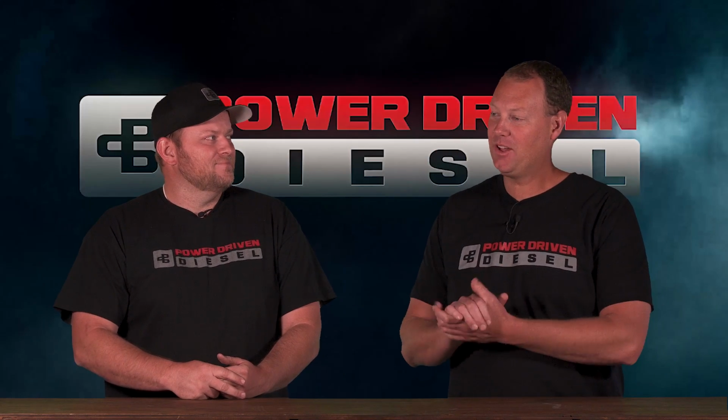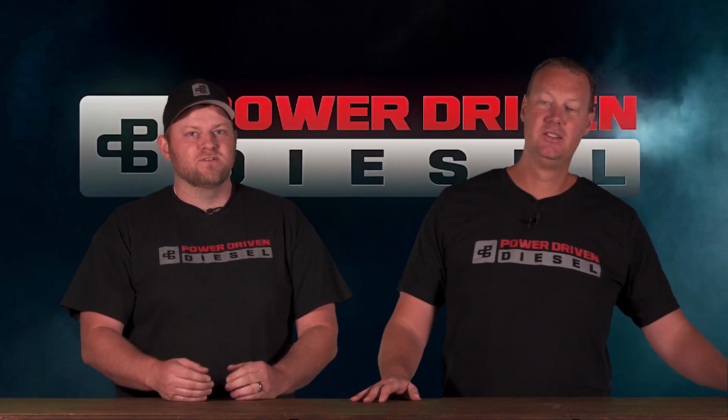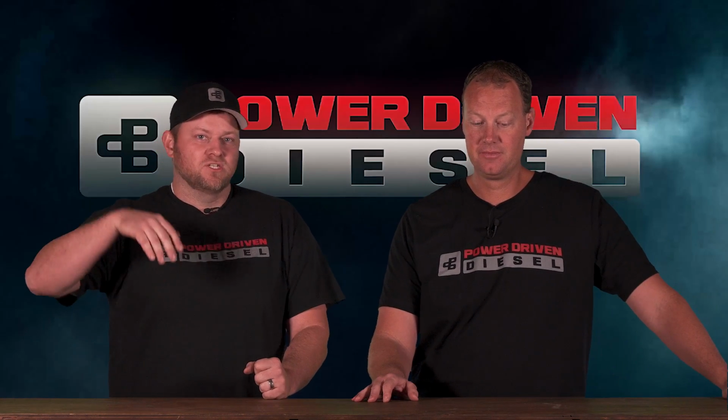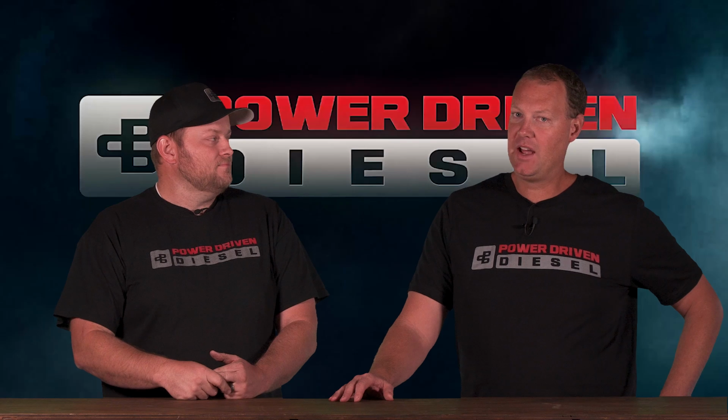So we got new calipers, so now we can stop, and then rear brakes, you gotta upgrade the wheel cylinders. Factory wheel cylinders suck. Chevy 1-ton wheel cylinders are bigger. You get more brake power with the same brake pressure. This is a mod that's been out there forever.